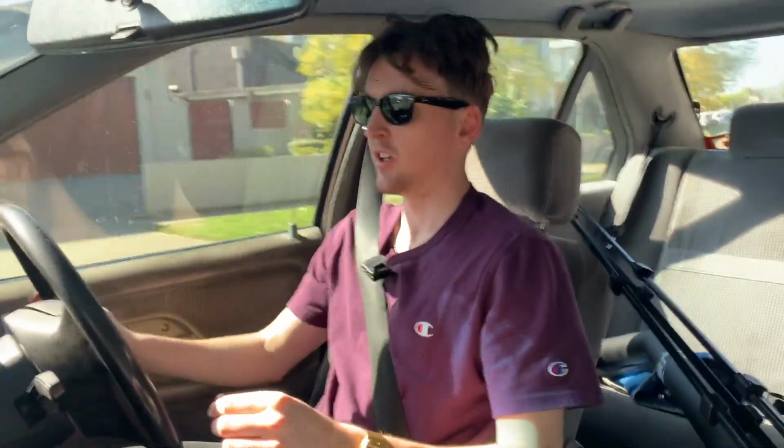Now, there are claims that it is a lot better on fuel economy, especially in these naturally aspirated engines, because there's back pressure, and these NA engines actually run better with back pressure. A turbo likes the flow, but NA likes the back pressure. Now, as I discovered when I was checking this exhaust out, the cat in this has been bashed out. I swear I had nothing to do with it, but it's fully bashed out. So it's already got a lot of flow. But as long as you have 1 muffler at least, you'll be fine.